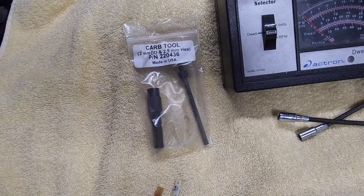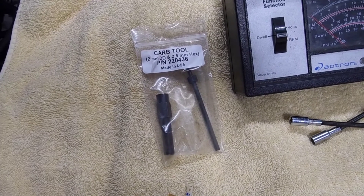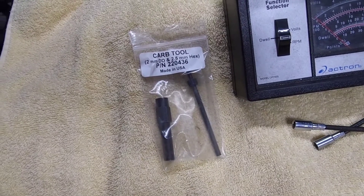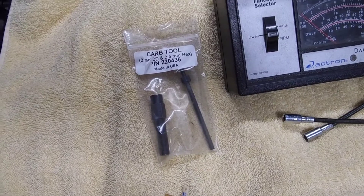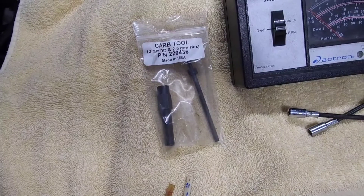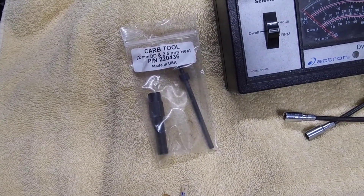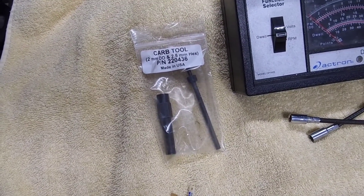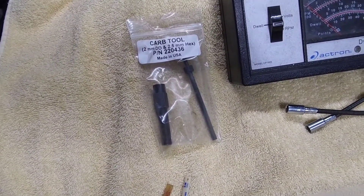So stay tuned, let's get started. The first tool that we have laid out here is a 2.5 millimeter hex adjuster — that's the tool in the bag on the right. This tool is used for adjusting the voltage that comes out of your throttle position sensor and properly applying enough preload so that the ECM can tell how hard you're pushing down on the gas pedal. In the next video, I'm going to show you how to properly adjust your throttle position sensor using this tool to make sure that the ECM can read it right and deliver the correct amount of fuel to your engine.